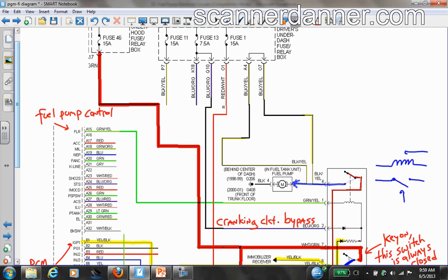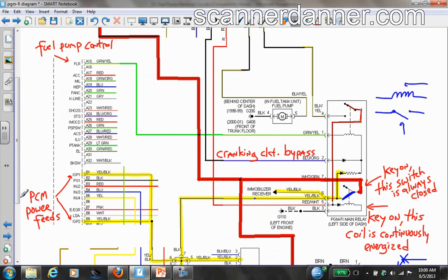When does the fuel pump run? Not all the time — only with key on or cranking. With key on it runs for about two seconds, and we need an RPM signal. Now let's look at the control side of the top relay. We have a coil of wire — it needs power and ground. The green-yellow wire goes to the computer, labeled FLR. We don't yet know if the computer switches the power side or the ground side — whether it's a high-side or low-side driver.